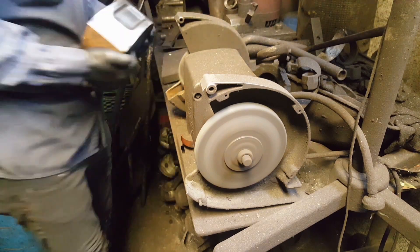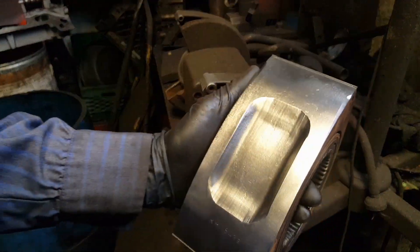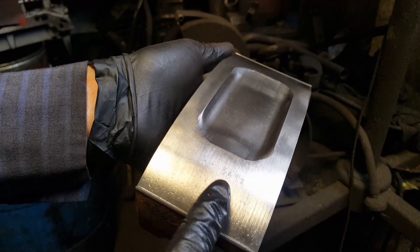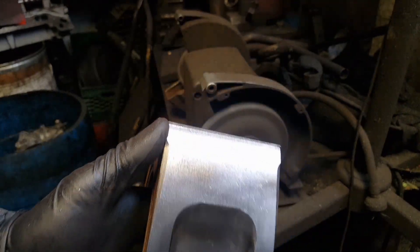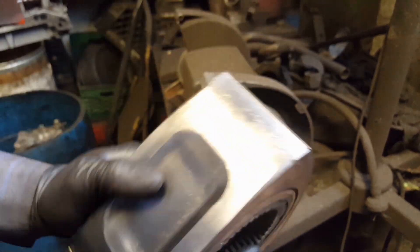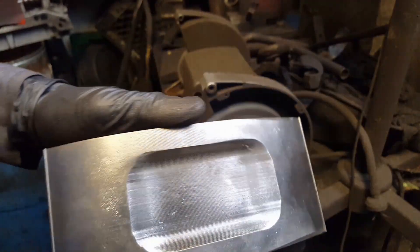So we have the other face. It's looking clean. As you can see the markings here — it has an R, which is the rear one. 545. It's looking good. There's some little spots there, but that's nothing, because remember what does the compression with the apex seals. So two faces, they're good. One more to go.